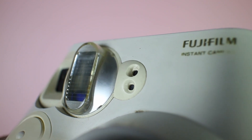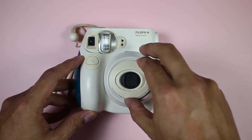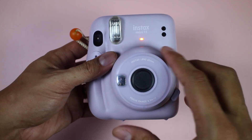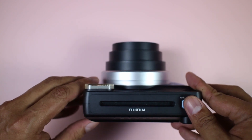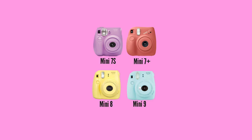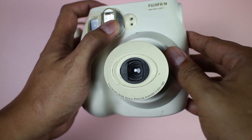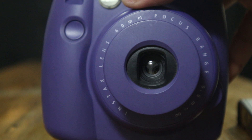Next, check the lens and the shutter. Check if the lens extends and opens the lens cover — on some cameras the lens cover gets stuck and may need some work. Check if the lens extends properly and there are no weird grinding noises. For the single-digit cameras — the 7, 8, and 9 — check the lens settings rings: when you click them they should change their size and be properly aligned. A broken or misaligned ring is easy to spot.